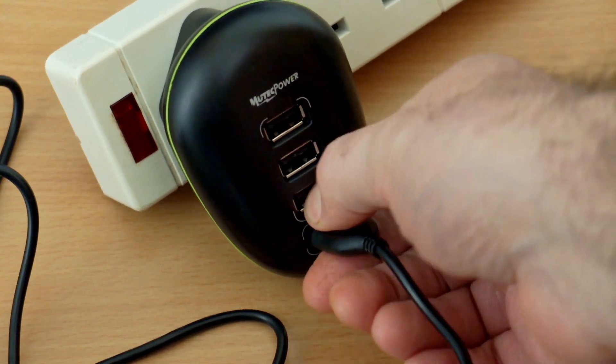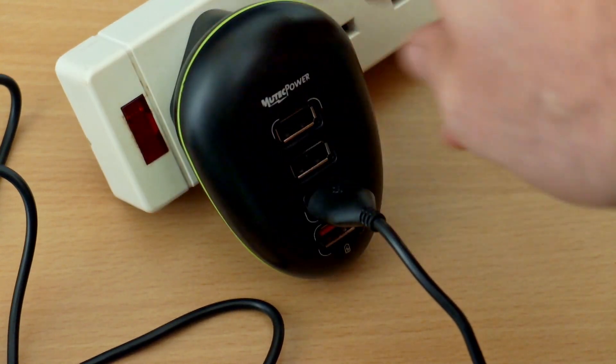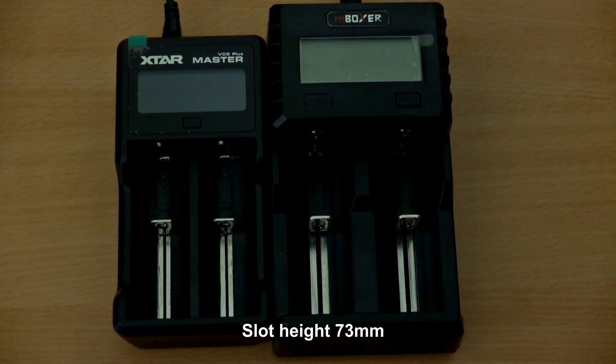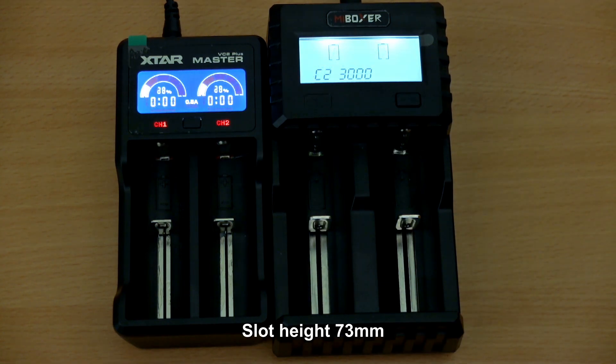Because this is powered via USB, you need to bear in mind that you'll need a fast charge port. The red one I had it plugged into is a fast charge port, whereas the black ones are the slower 1-amp computer ports. Some ports are only half an amp, so if you want to use fast charging you will need a high-power USB port.